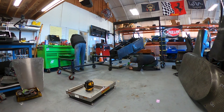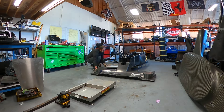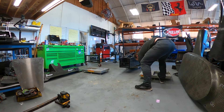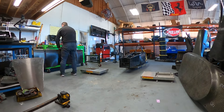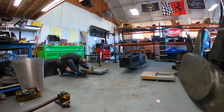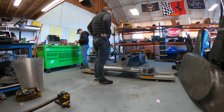I'm going to first start off by getting a level working surface. For me the level working surface is going to be made up of four scale pads — two for the frame and two for the front splitter. They're all going to be working off of the flat plane and I'm going to use shim stock to make sure that everything gets to the right height. It's an easier way to make quick adjustments. One of the other things that's important is to make sure that the pads make the correct contact, so I was checking to make sure the splitter landed prior to making sure that it was level.